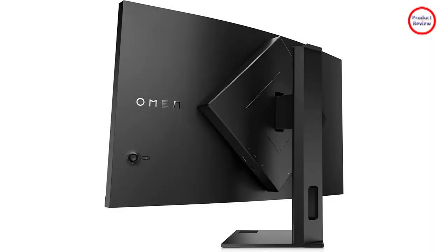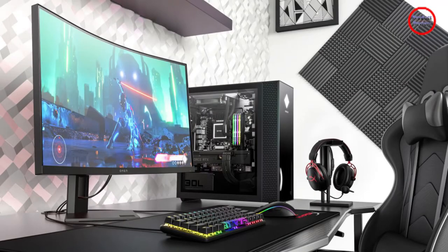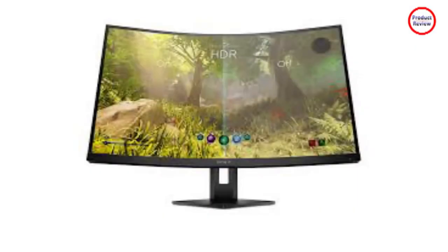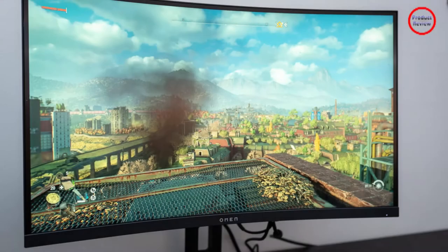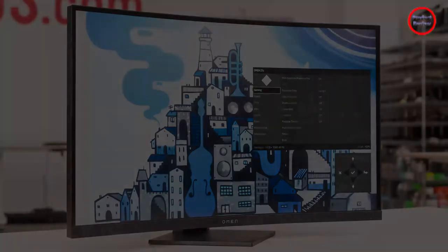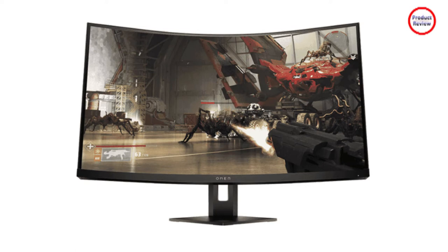The diamond base goes a long way toward reducing the footprint on your desk, making stands like the one on the LG 27GN950 feel downright massive by comparison. There's a headphone rest on the back of the stand, too, which is a tidy addition. However, the stand offers only 130mm of height adjustment and a few degrees of tilt, with no swivel adjustment. You can use a 100mm x 100mm VESA mount, but it's rotated at a 45-degree angle, and the ports — stretched across a diamond on the back — are frustrating to reach. You have to tilt the whole monitor to see them, and some swivel adjustment would have helped.